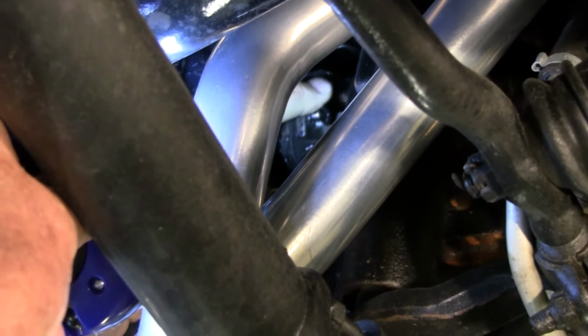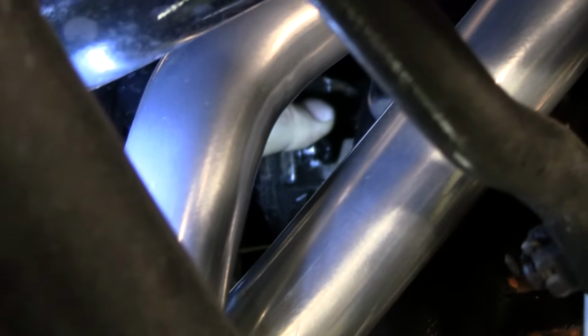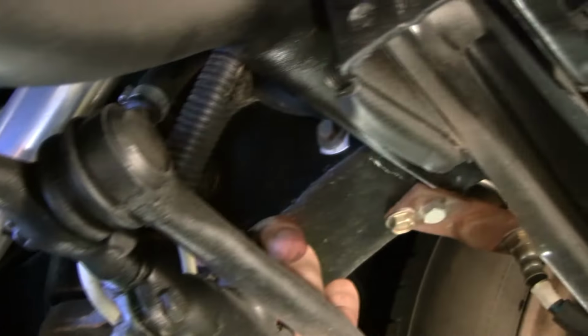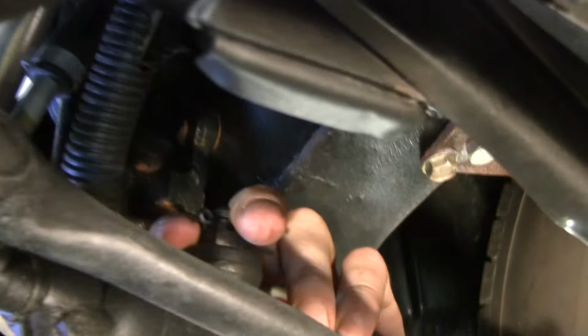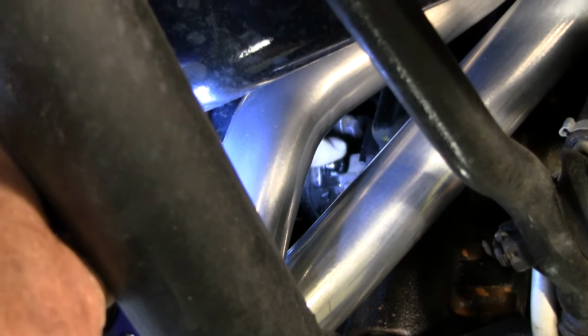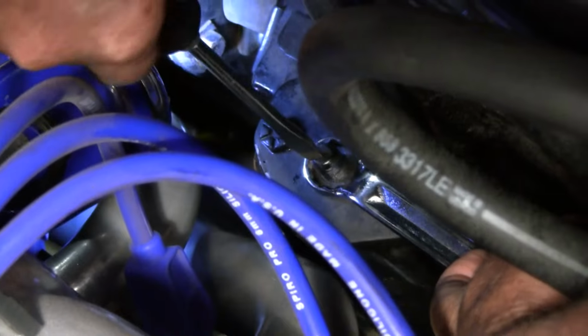Okay, I'm moving the rag joint ever so much. I'm going to grab onto the pitman arm, and I got a ton of slop in here. Look at that. I'm getting no movement on the pitman arm, and look how much I'm moving the rag joint. I can see that. Yeah. So let's adjust this one and see what it does.